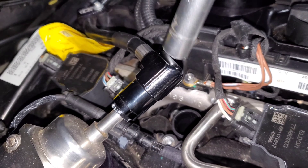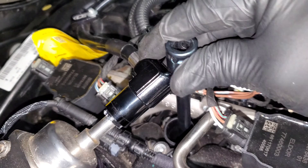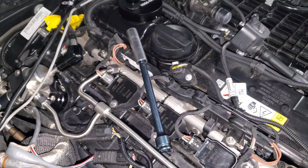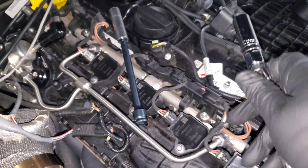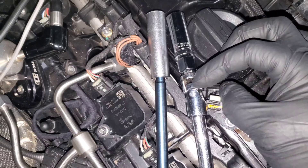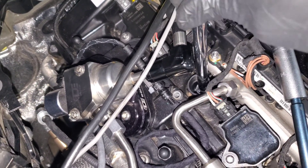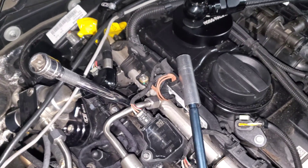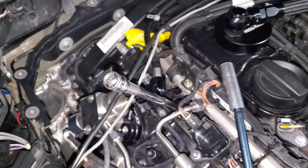Getting the swivel in there for cylinder five, it's hitting too soon — the adjustment point is a little too low to navigate around the HPFP line. So I went back and put a swivel on top of the plug tool, and just that extra couple of millimeters of movement — shifting the adjustment point up — allows me to get the tool all the way down into the hole. I can feel the resistance; I've got the plug. It's tight on space, so it's critical to have the plug tool with a wobble extension on top to give you that extra adjustment to reach cylinder five just fine.